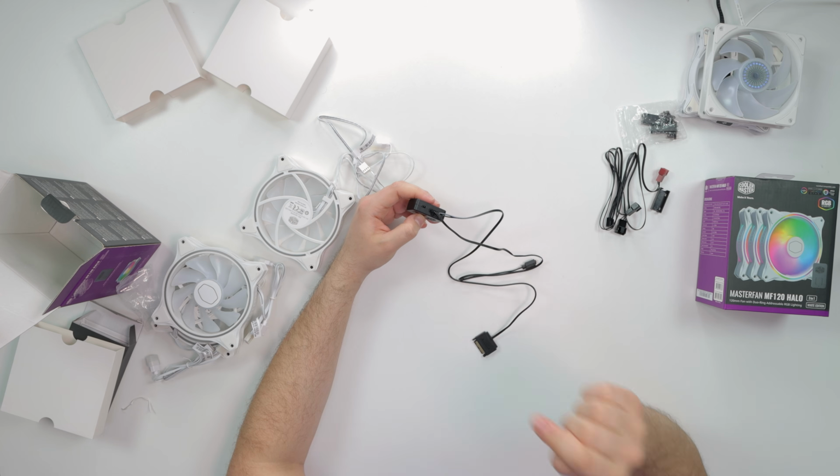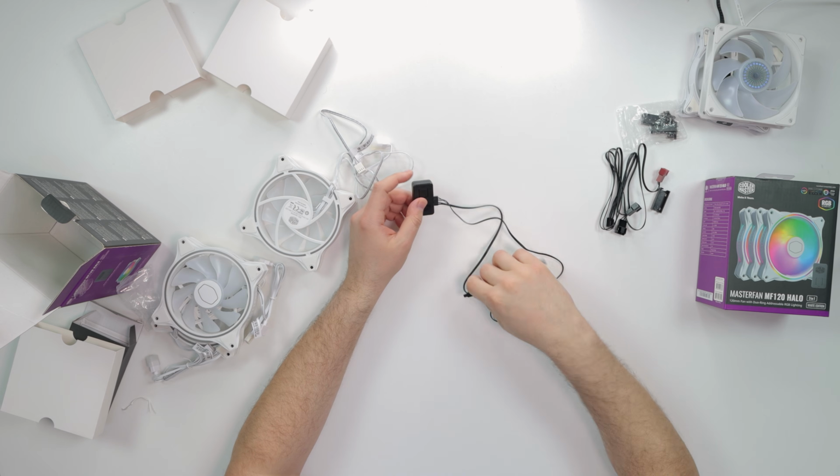Let's say you don't wanna use the addressable software, or you don't have a 3-pin aRGB header on your Mobo, and you only have a 4-pin RGB header. Without the aRGB header, you won't be able to use the software. So if you want to change the colors, you could press this, or the restart button. If you plug the restart wire into here, you press the restart button on your case, and it's going to cycle through colors and whatnot. So anyway, this is plugged in, let's say.